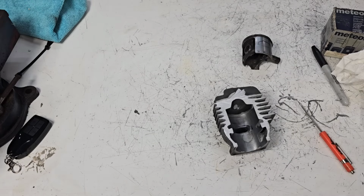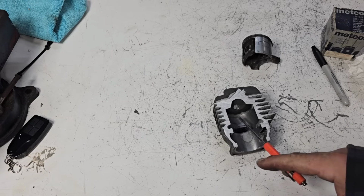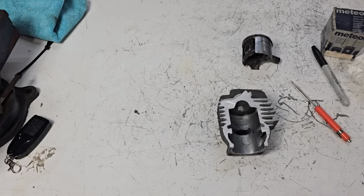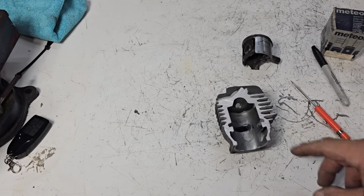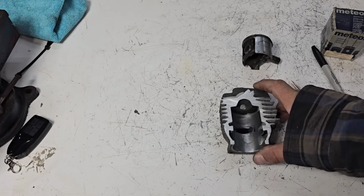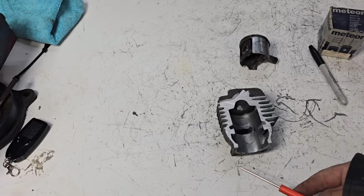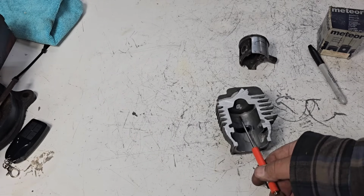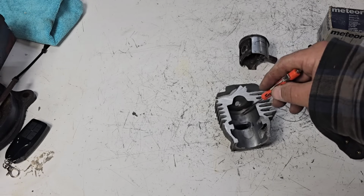I don't know if you have access to a lathe, Doug. Maybe you have a buddy that does, but you could lower this cylinder, say, maybe 40 thousandths, and get rid of your base gasket. Now, Doug mentioned that the saw he has like 50 thousandths squish with a base gasket. So rip that base gasket out of there, Doug. You'll probably have 30 thousandths of squish. I think I said degrees before, but it's actually thousandths.